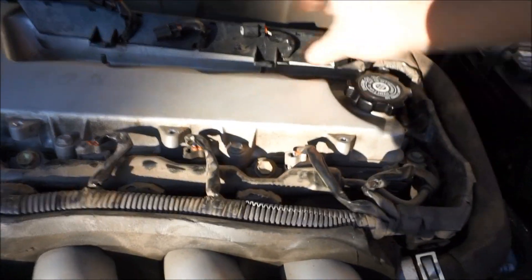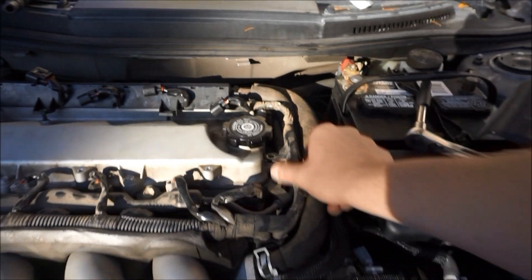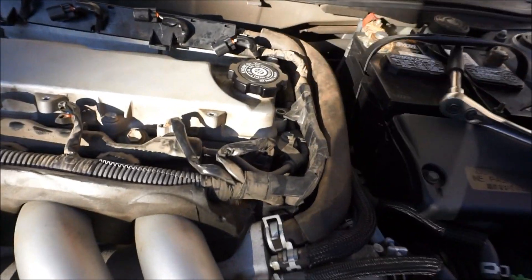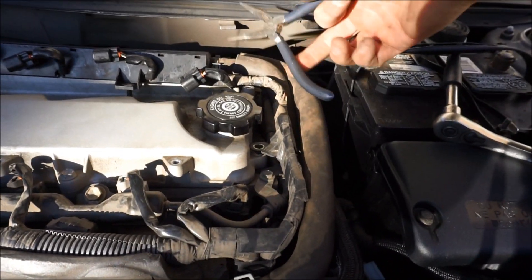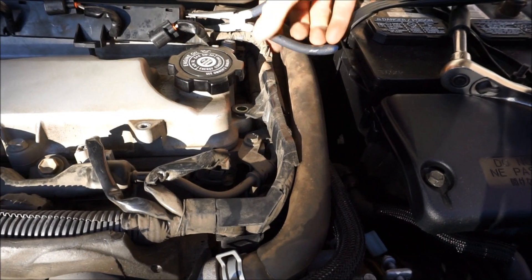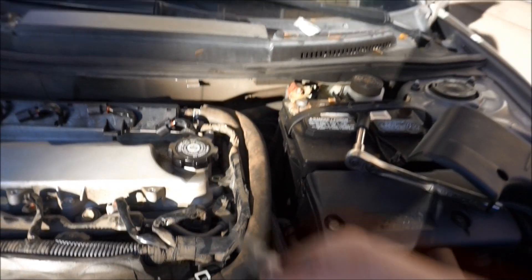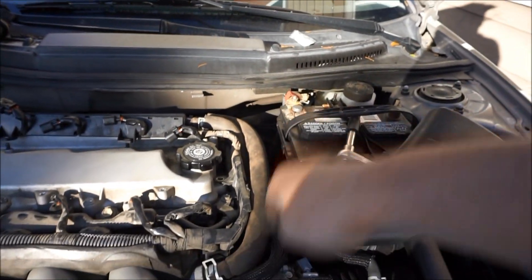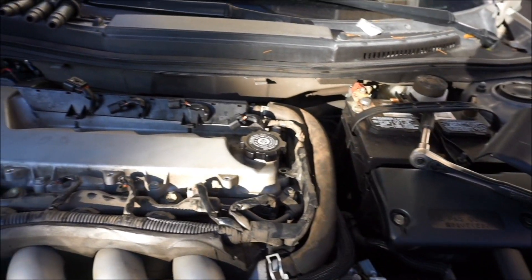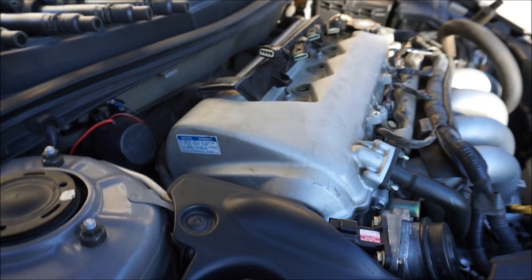You're about a quarter of the way in. This is now free to move around. The next thing is to unclip and pull the vacuum lines out. We're gonna do the pressure and the return for the intake manifold so that this can come off — because the real goal we haven't really talked about is getting underneath the valve cover. That's what we're trying to do.